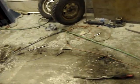When I did my first O2 sensor test, I shoved my exhaust sensor into the tailpipe. That was incorrect test procedure. I was up 40 hours that day, didn't think about it, slept, figured it out, came back and retested. Actually welded an O2 bung.